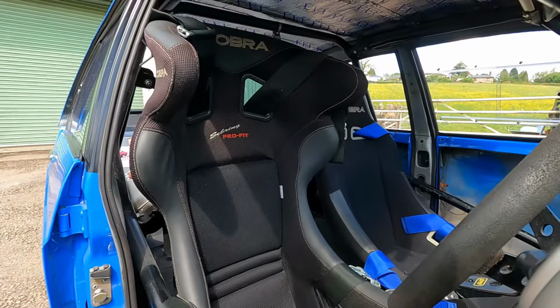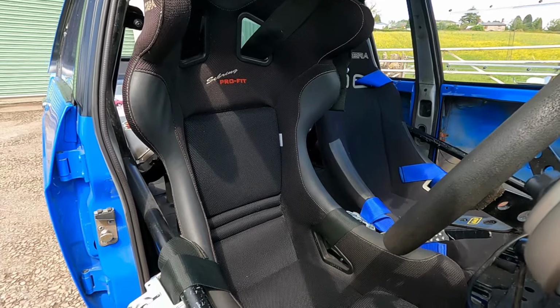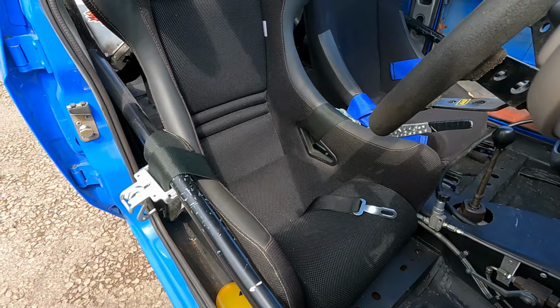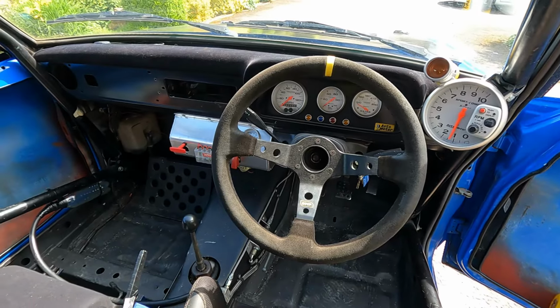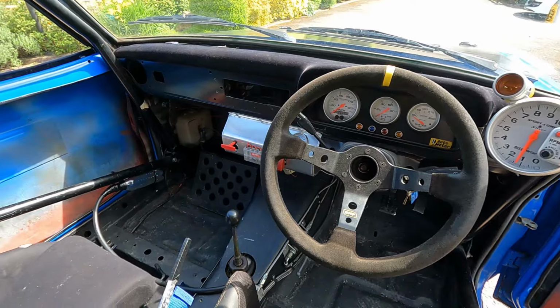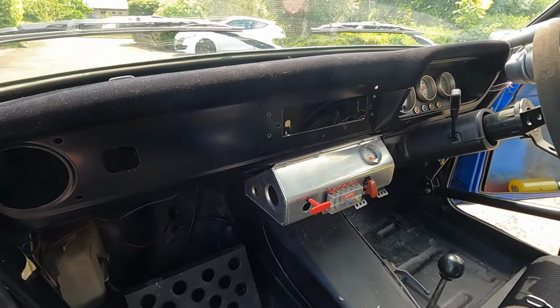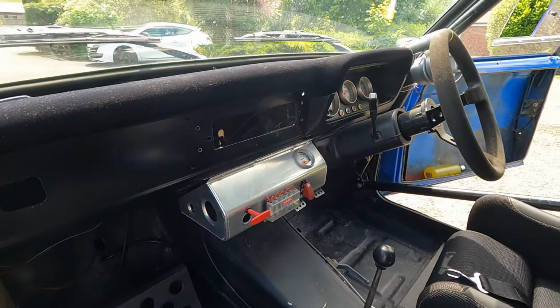Yes, it's right. Permanent lock, it just wants to go in a straight line. What can you do to help traction off the line? Because this is all leaf springs, isn't it? Yeah, it's leaf springs. So we've got traction bars on the back to make the tyres grip. How much slip do you get? If you get it right and you've got the traction bar set right, I actually got it perfect on one of the hits. The axle gripped that hard it broke the leaf spring bolt.